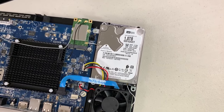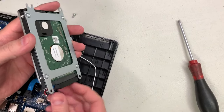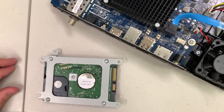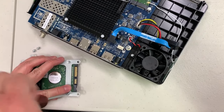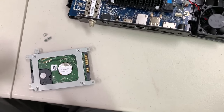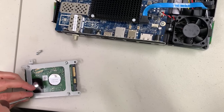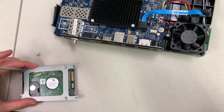If you're here to change your hard drive, it's not much more complicated. There's just one more screw — generally a T10 — get that screw out, pick up the hard drive, and rotate it over. Then pull off the big connector, which is the power and data combined in one SATA connector. The drive has four screws holding the bracket on; take those four screws off. Have your new hard drive nearby so you can get the orientation right. Always be gentle with the screws on hard drives.